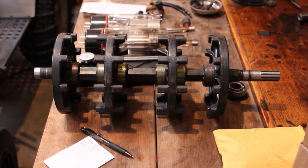Well, voila, there. Once again, with the power of YouTube, what took me about 2.5 hours was only a couple seconds for you guys. Pretty dang time consuming with just a manual shop press doing that. Pressed the drivers off of the Renegade drive shaft, and then, like I said, the drive shafts happen to be the same diameter, so as long as I got the measurements right that we took beforehand, just pressed them right back on into the respective positions.